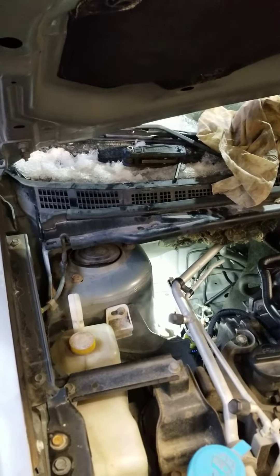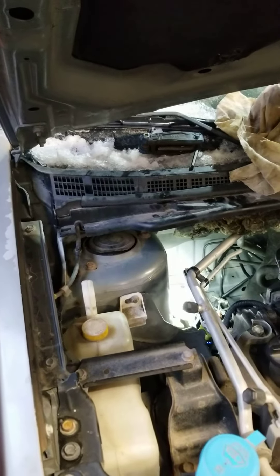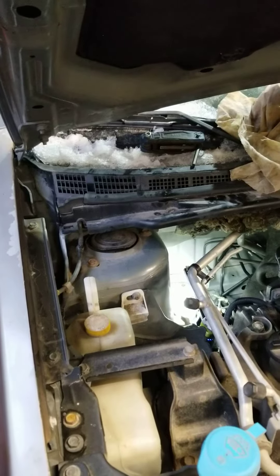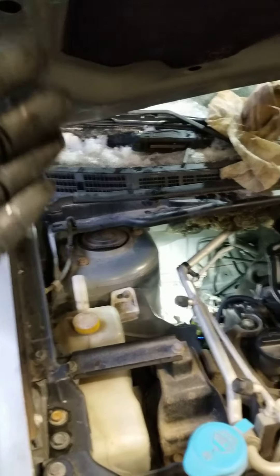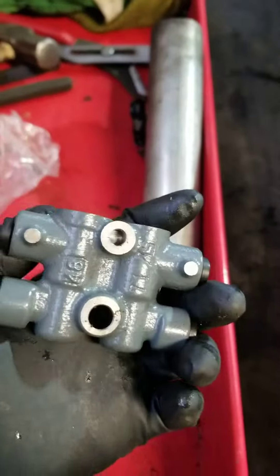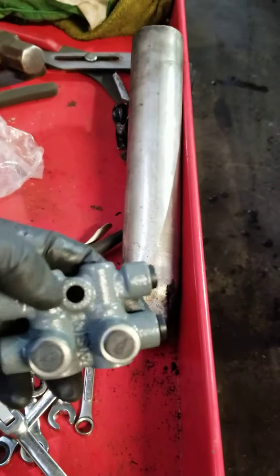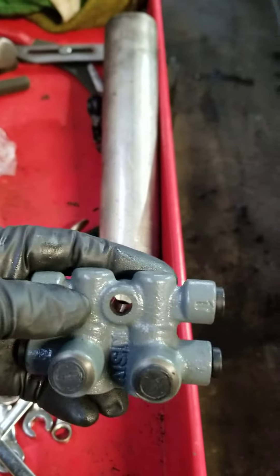I put a new hose and it's not the hose. I disconnected the line and actually no fluid goes into that particular line. Everything else is okay. I also disconnected the line up front by the motor bay and fluid comes out from everything else, but not from the rear line. So that means one of these things is stuck closed and doesn't allow the brake fluid to flow the way it's supposed to.